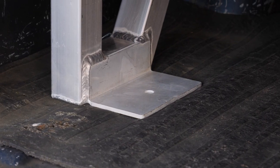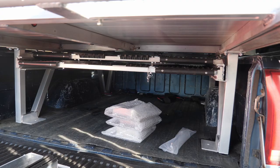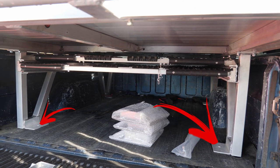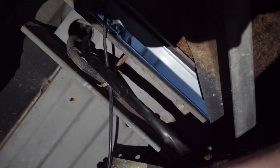You'll need to find a drill bit that's the same size or slightly larger than the supplied bolt that Marlon gives you, and using the holes on each of the 4 feet, drill all your holes, slide your bolts through, and using the supplied blocks on the underside, tighten all 4 bolts down to your bed.